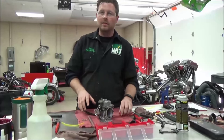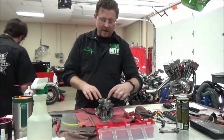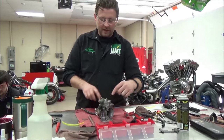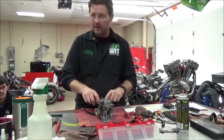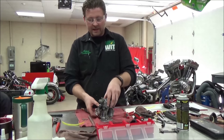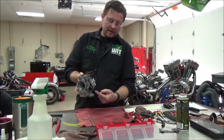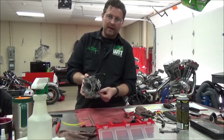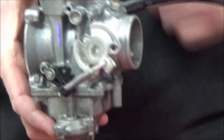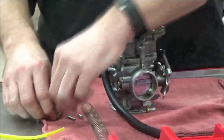Here's where we get into trouble — brackets and clamps on the motorcycle. You dirt bike guys, remember how many clamps you had for hoses, and where does each clamp go? I have to use the parts fiche to determine that. I want to take the carburetor in the right direction, and figure out where Honda, Suzuki, Harley — whatever — had a clamp. I want to put it in the right spot, because contact with a clamp or hose in the wrong place will cause a problem. It's important to be diligent about following the microfiche and putting everything in the right way.